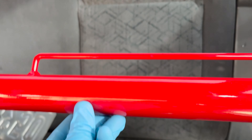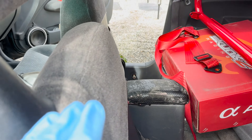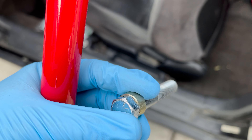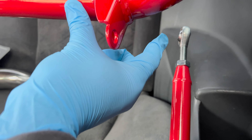The bar isn't going to sit too low or too high — it'll sit kind of parallel with the top of the seat, at a slight angle. That way the rod attaches to the mounting point and you'll be able to run the harnesses out and down. I'm adjusting the rods and attaching now. Got my bolt, got the spacer — lines up straight. I'm adjusting the rod to fit through here; remember this is the smaller end, the 17mm side.